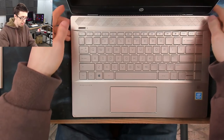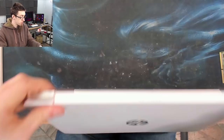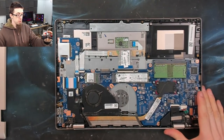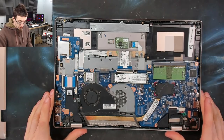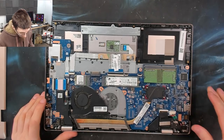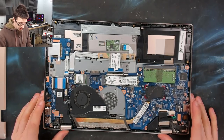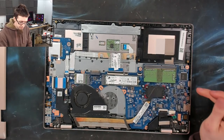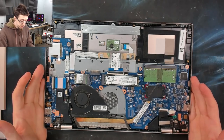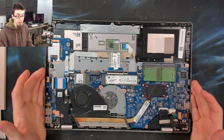So what can we do about that? We've already changed the memory, already tried to reset the BIOS, and on modern laptops like this HP you very quickly run out of things you can do. That leads us into some kind of physical connection issue on the motherboard, or a BIOS problem. The interesting thing is when you Google-search that error code, it actually means — and I quote — "the EC, the embedded controller, timed out waiting for the BIOS to detect the memory."